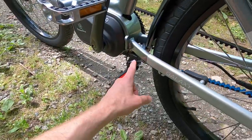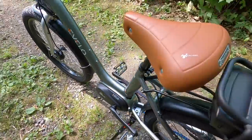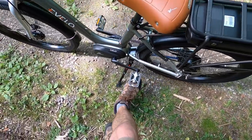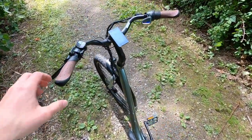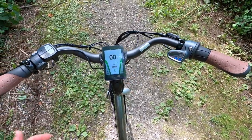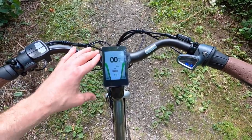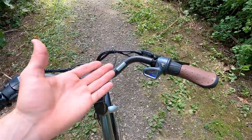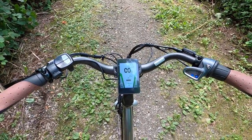I'm going to complain here for a second — they've put this kickstand right at the center of the frame and it creates pedal lock. You can see a little scratch right there, which happened when I was walking the bike out of my yard earlier. You walk it backwards and it collides, and then it doesn't automatically go forward — you have to kind of kick it up with your foot. So for me that's a little gripe, but it's worth calling out. Avelo has addressed a lot of complaints I had in past iterations, but they've lost the USB charging port, which used to be on their display. They switched to what they say is a more reliable display — it's beautiful, it's very big and it's color, adjustable angle but not removable.